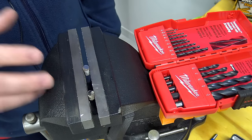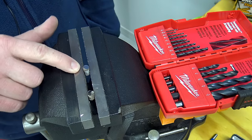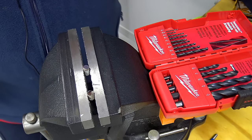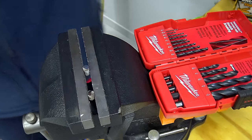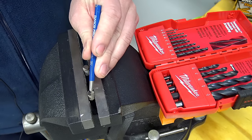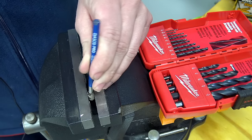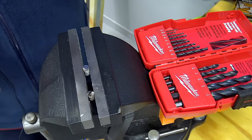We're going to drill these out on the vise here — just imagine this is the lower stud that's broken and this is the upper stud that's broken. We're going to start off with the lower one first. I was able to use a center punch on this one and center punch it just a little bit. You want to center punch it in the center the best you can. They're not always going to be nice and flush; that's where the center punch comes in. Hit it once, get it centered, hit it again, and after that you should be able to start drilling.